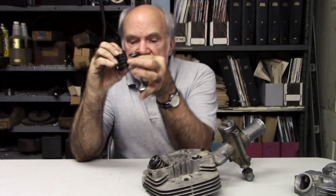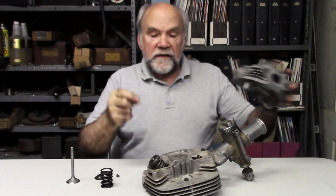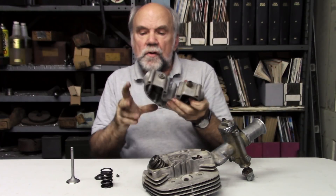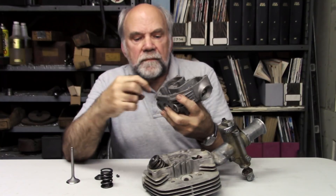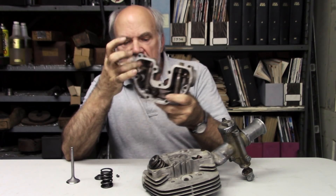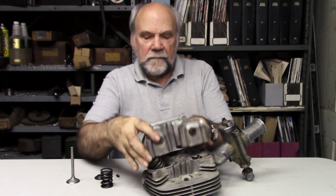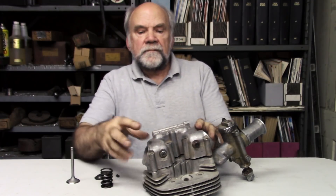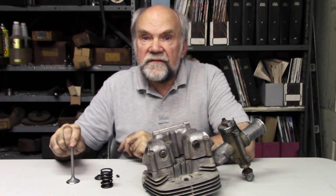These springs are much too stiff for me to compress with my fingers. So when this is all assembled, how does the valve get opened? In the case of this engine, there's a so-called rocker arm box, or rocker box. Inside of it are these rockers. Coming up from the crankcase level are push rods that push on these parts. This part presses against the exhaust valve stem, and this one against the intake valve stem. When the push rods make their movements, the rocker arms transfer that movement to the valves.